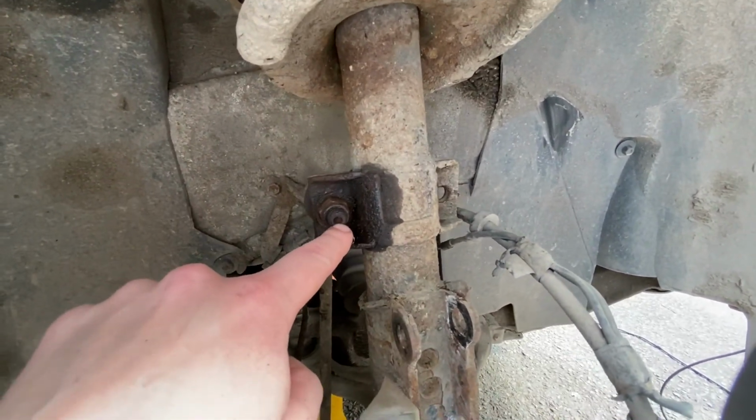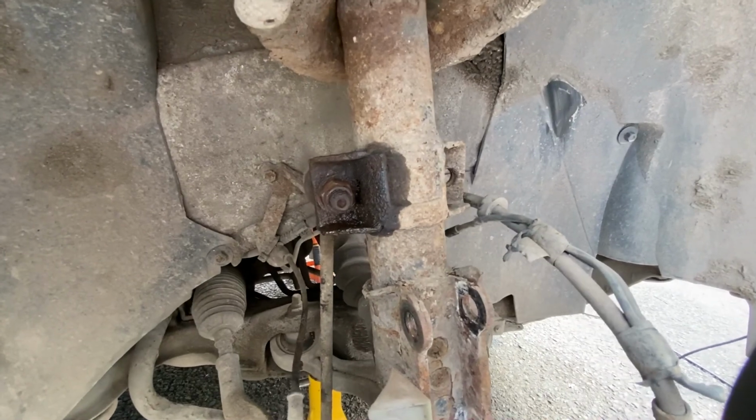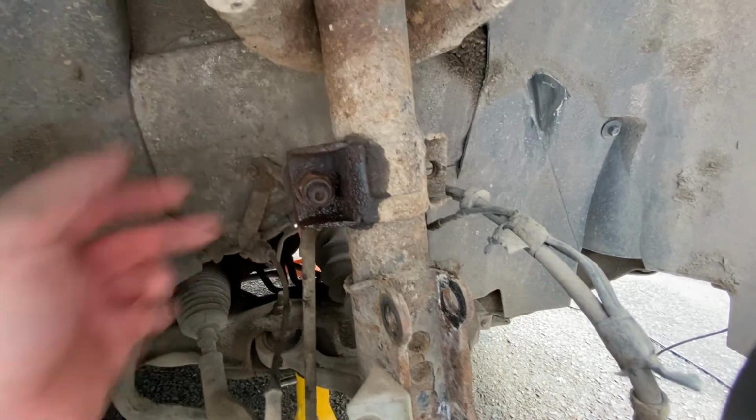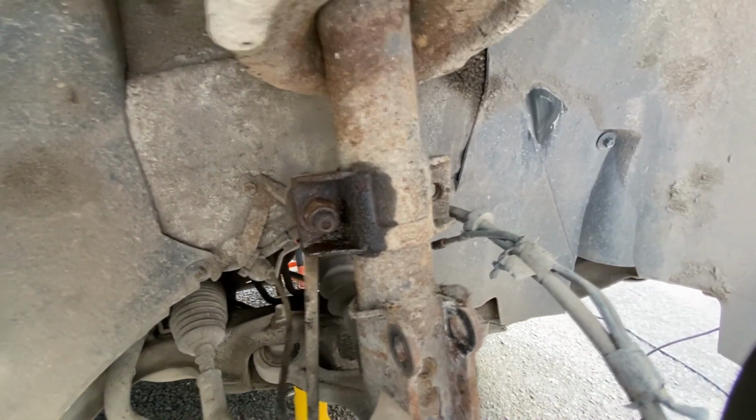So the Allen key socket in here was stuffed full of crap. I tried cleaning it out, but it's rounded. I hate these types of fittings. The ones that have got a flat on the behind are much easier because you can put a spanner in there, impact gun on there, and they come off in no time at all.